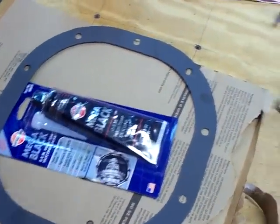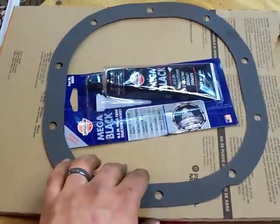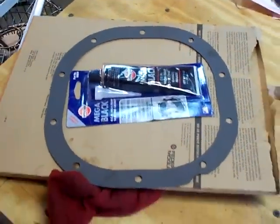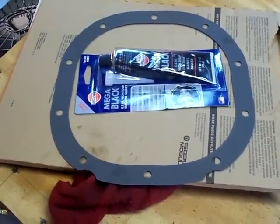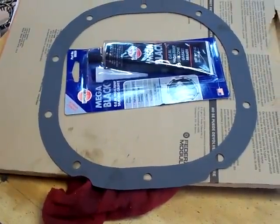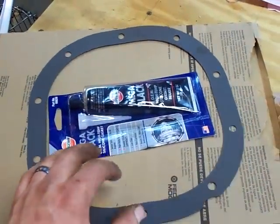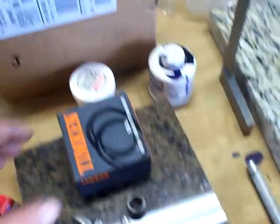I'm not an auto mechanic — I'm actually an industrial maintenance technician, and I work with lubricant failure problems quite a bit. That's one of the main things to be concerned with. If you keep track of your fluid levels and make sure you don't have any lubricant leaks on your automobile, you'd be set for a long time. Recommended change intervals, no leaks, use gaskets when you're supposed to. I see rear ends all the time with no gasket, just Permatex, and they're leaking.